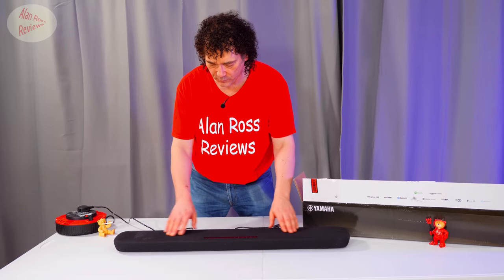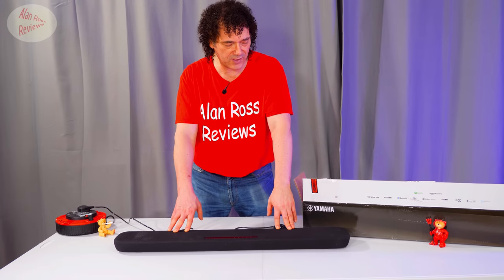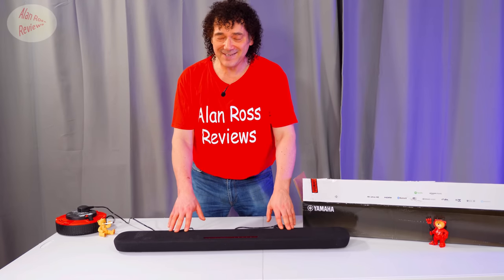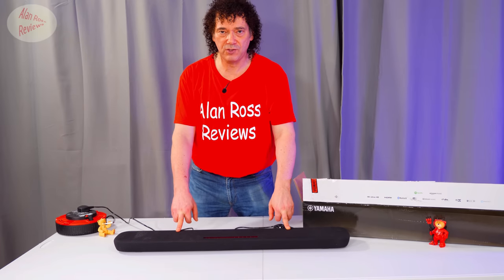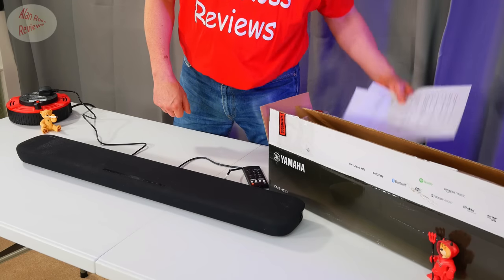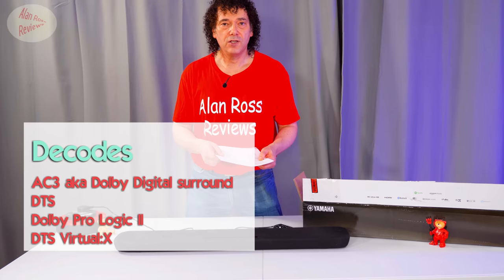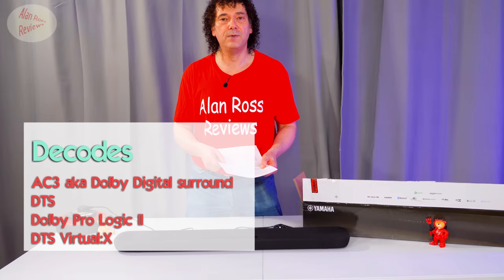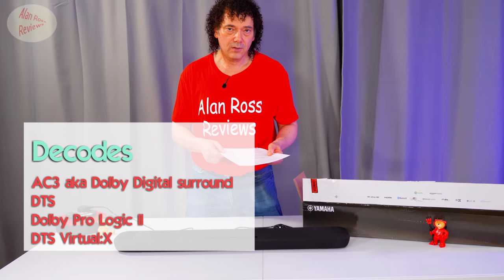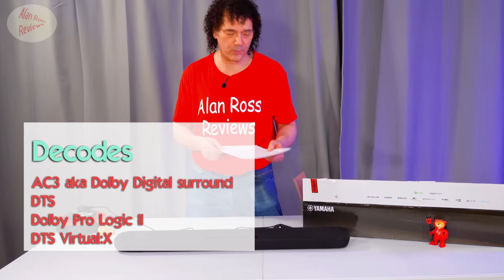You've also got the subwoofers — loosely calling them subwoofers — down to about 60 Hz on the official specs, which isn't low. With dedicated home cinema kits you want to get down to about 10 to 20 Hz. So this is not going to replace a dedicated home cinema kit; it's going to upgrade your TV system. So what can it do? It can decode AC3, also known as Dolby Digital Surround. It can decode DTS, and of course it will decode Dolby ProLogic 2, which is a way of upscaling stereo two-channel tracks to 5.1.